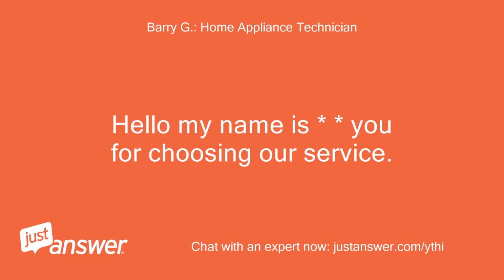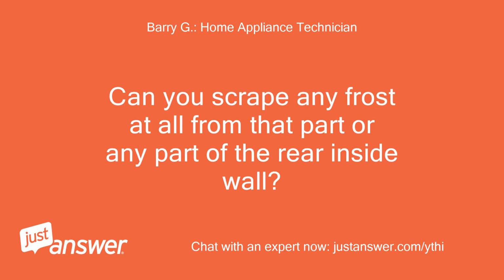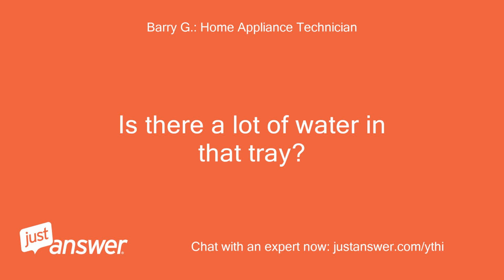Hello, thank you for choosing our service. Take a look at the lower rear part of the inside of the freezer wall. Can you scrape any frost at all from that part or any part of the rear inside wall? If you find nothing, go around and look at the compressor. There's a tray attached to the side of it. Is there a lot of water in that tray?